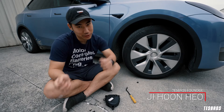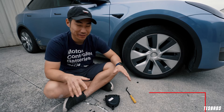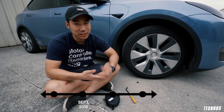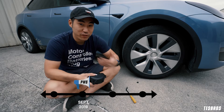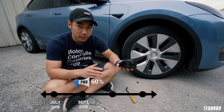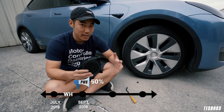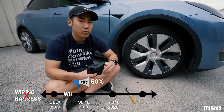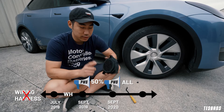You've probably had an incident where you were getting groceries and the people in front of you had no idea you were behind them because your Tesla is so quiet. Back in September 2019, NHTSA required all Tesla vehicles to have some sort of sound-emitting device for 50% of their vehicles. If you have a car built between July and September 2019, it typically has the harness, but anything before that doesn't. In September 2020 they required all vehicles, so any car past that mark most likely has this.